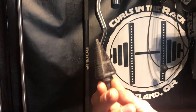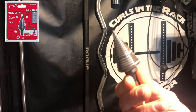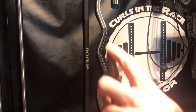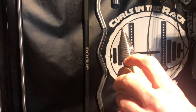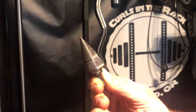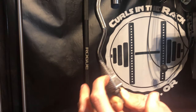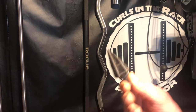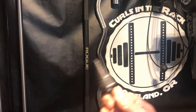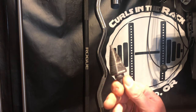This is called a step drill bit. It's called a step drill bit because there's like little stairs here — steps. What it does is basically you can get any size hole you want, because there's little measurements on here. What we're doing on this hole at the top portion of the cross member is a one inch hole. It's going to keep chunking it down and making it a little easier for you, and you can take it off and check and measure. We can also do a five eighth inch bit hole, so this works for both of those holes. It works a lot better than a regular drill bit — it does not take as long. It's like $50 or maybe $40 or something like that, but it's definitely worth it for these kind of projects.